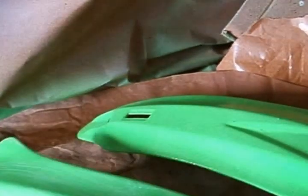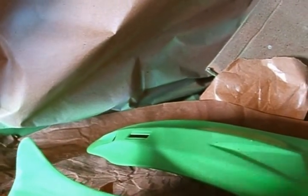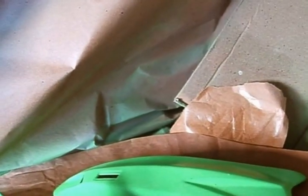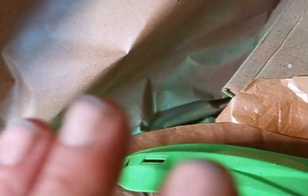When I first started doing paint jobs, I always wanted to go straight from 60 grit to 2000 grit to save labour — but you just can't do it. You have to be patient. If you scratch with 100 grit leaving deep grooves, then smooth with 1000 grit, you'd end up with a glossy surface with scratches in it. The way to do it is in stages: 100 grit to 400 grit, which removes all 100-grit scratches but leaves 400-grit scratches. Then 800 grit removes those. Then 1000 to 2000 grit, and eventually the scratches get smaller and smaller until you can't see them anymore.